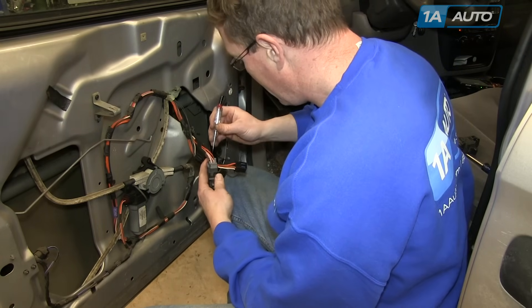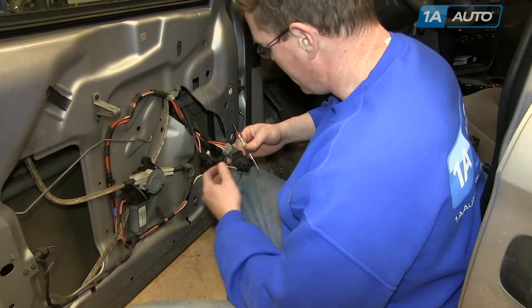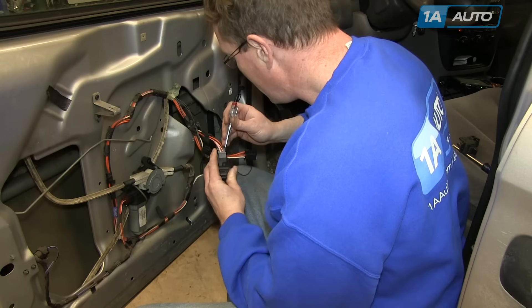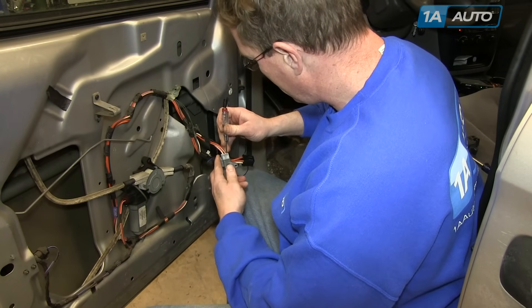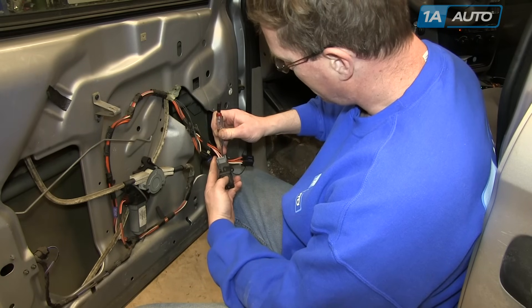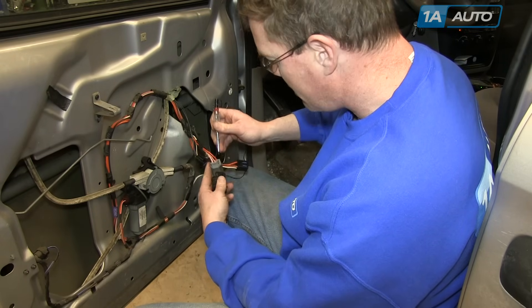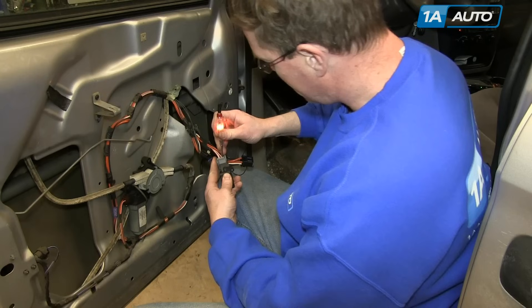There's power going into the switch but nothing's happening. Looking at my power window motor, I've got an orange with a white stripe and an orange with a green stripe coming out of the switch. I can probe the orange with white stripe — I'm holding the switch, let the switch out — power is going to the orange with white stripe. Power is also going to the orange with green stripe. So now we've ruled out the switch; we know the switch is good. Power is coming into the switch, you activate it one way and one wire lights up, activate it the other way and the other wire lights up. The switch is doing its job, directing power from the main supply to whichever wire runs the motor.